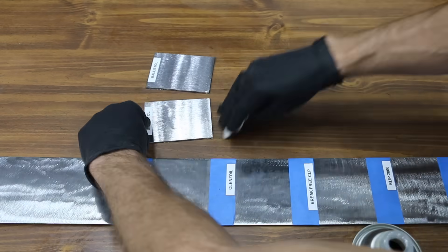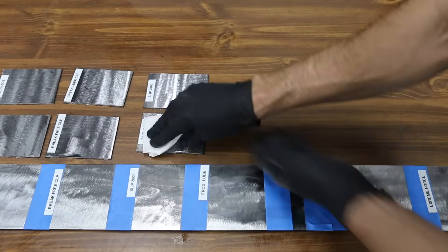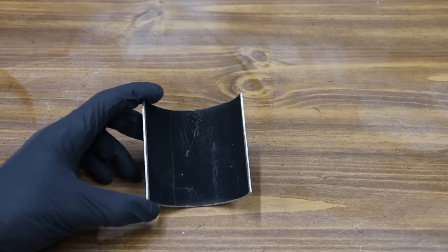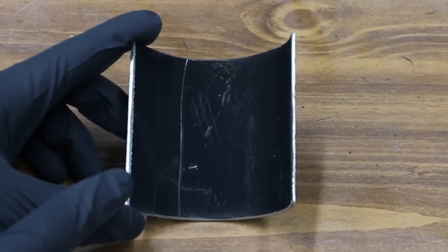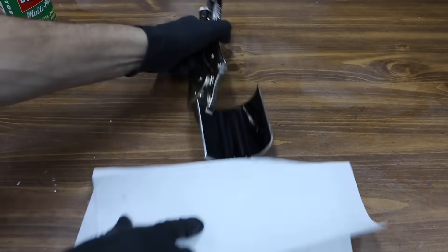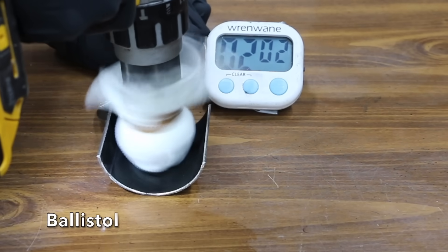To get ready for the next three tests, let's apply products to the test coupons and a long strip of metal. After applying all the products, I'll wipe off all excess liquids and allow two hours for the products to soak into the metal. For the cleaning test, with 100,000 miles and about 15 years of diesel exhaust exposure, each product will get two minutes to dissolve the carbon buildup. I'll then use a drill with a microfiber towel for about five seconds to see if each product can remove the carbon, replacing the towel between each brand.